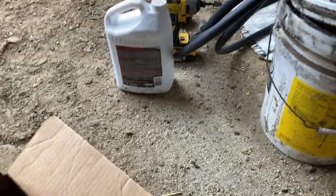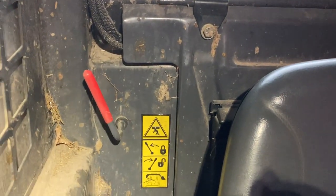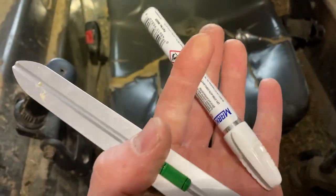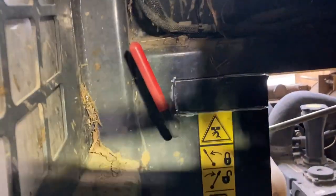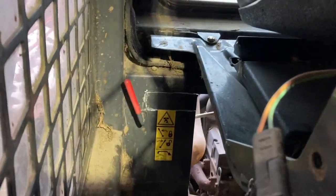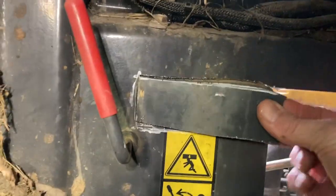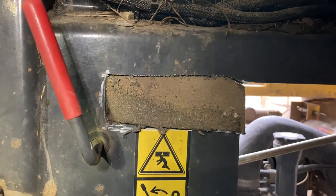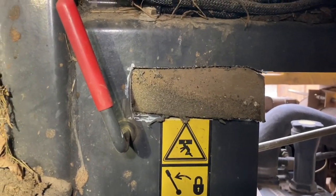We've got the heater mounted now and we're going to cut a little square spot right through the top of the firewall so we can fit the two three-quarter inch hoses through it. We used a paint marking pen and a level to create a straight line, then made the two long cuts with a Sawzall, used a cutoff wheel for the straight up-and-down piece, and a Sawzall to get the corners. We left the foam on the back side so we can wrap it around the hoses when they come through. There's the piece removed — that'll give us a spot to run our two hoses through.